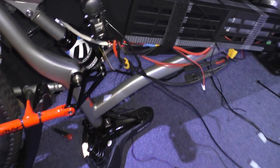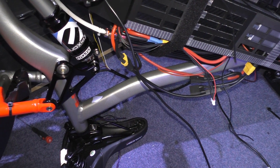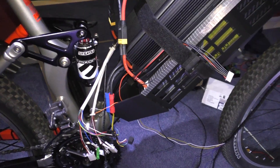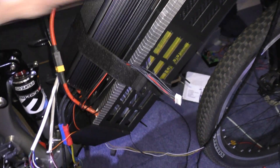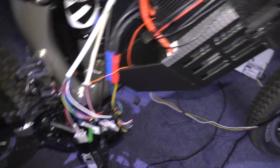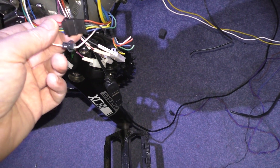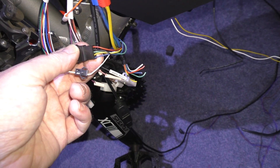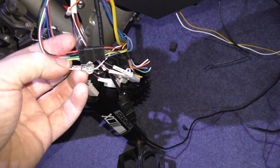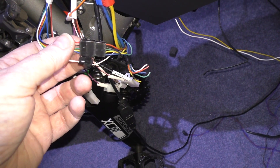So that's the wiring done - I'll turn it the other way again. God, this thing's heavy - it's over 40 kilos now. This is the very base that you need to get it working. The hall sensors - which are those there - I've wired those up. You've got the positive, the negative, red, yellow, and blue as normal. So I've wired those. Incidentally, I'm not using their connectors - I hate them.